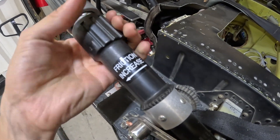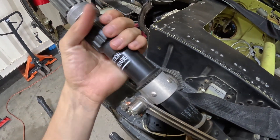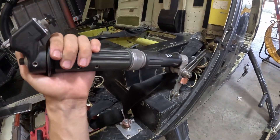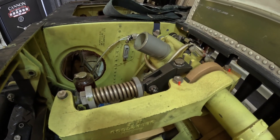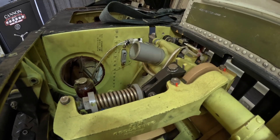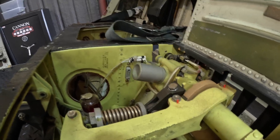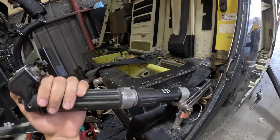There is also a friction adjustment knob on the collective. This allows the pilot to add or remove resistance in the lever. The purpose is not to lock the control in place, but to keep it from drifting due to vibration or light bumps from the pilot's arm. In addition, the system uses a bungee spring assembly. Without this spring, the forces on the collective would vary a lot depending on its position. At low pitch settings the control might feel very light, while at high pitch settings it would become very heavy. The bungee helps equalize these forces, giving the pilot a more consistent feel through the entire range of collective movement.